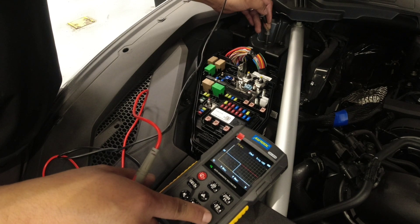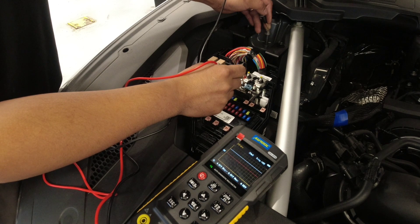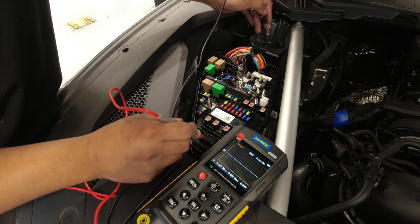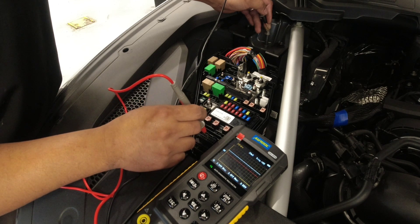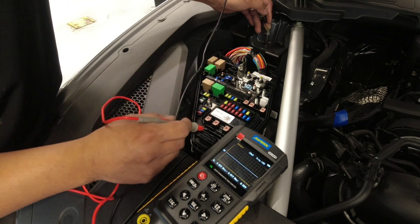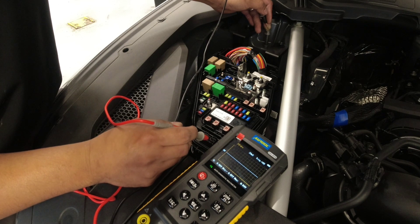Let me try 20 milliseconds — it'll go up right away. Okay, 12.56 volts. Going to our DeCAN — it's showing 2.6 volts. How about the low side? That's also 2.6 volts. So there's no waveform yet or a square wave. I'm gonna go to the CCP CAN network.